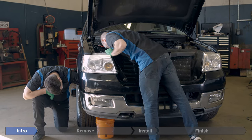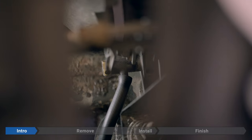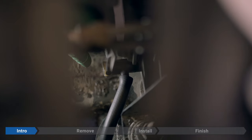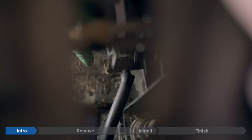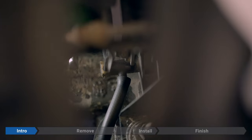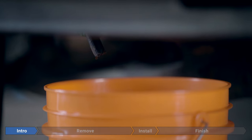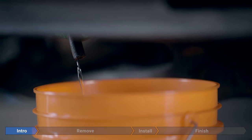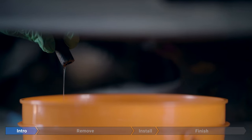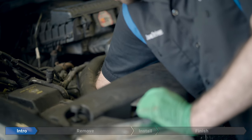If you've got an assistant around, it might be a good idea to get them to hold the hose in place — ours is a little short and we don't want to go spraying coolant all over the floor. Open up the petcock valve — that white valve right there. It might be a little tight if it hasn't been opened for a while. If it is tight, you can use a 19-millimeter wrench or socket. Just a couple of turns and it should start flowing. Once it's done draining, tighten it back up so you don't forget later.